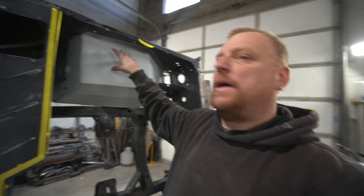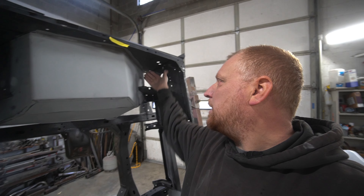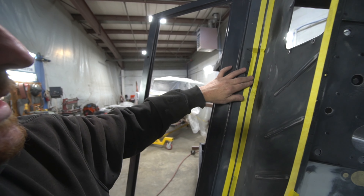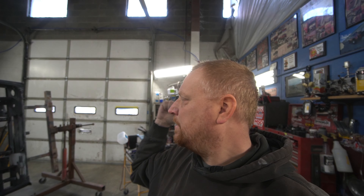Back here working on the '71 - got it all seam sealed. I did some body work on the inside of the wheel well - it had some stuff for like a jack or something, so I ground those off, welded those holes up. Had to do some body work - there were a couple holes down here, rolled up and a couple dents, so we fixed those. Right here was kind of boogered up so we did a little body work there. Also rolled up a couple holes for the throttle pedal - we're going to change the throttle pedal. The GoPro didn't record it, but same thing as the quarters - we back-taped it and got a real nice fine thin seam seal line. Got it sanded down and prepped, seam sealing it now. We'll let it dry overnight, clean it really well, and hopefully get it in the booth the next couple days to get some orange on it.